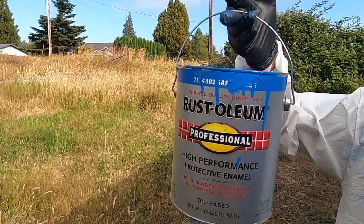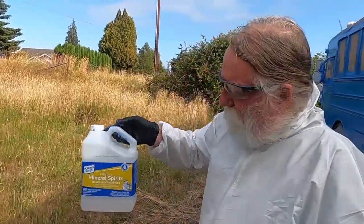If you're doing this from scratch going from yellow, sand it, do all the prep work, paint it with a gray automotive primer. Gray kills the yellow and is easier to cover up with a color than yellow. You'd still probably put two coats on. Originally I put one coat and rolled it on. This time I used Rust-Oleum from Lowe's — last time I used Ace Hardware's version. It's a shade difference, but the Ace around here didn't have it. It's just Rust-Oleum oil-based and they've got a bunch of different colors.